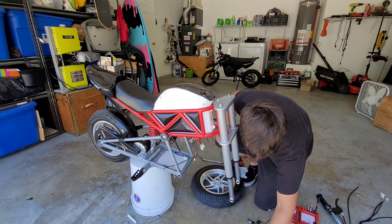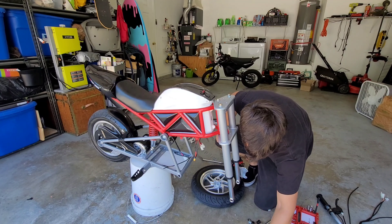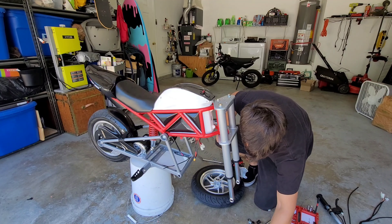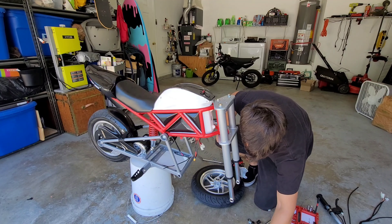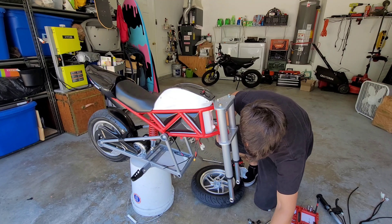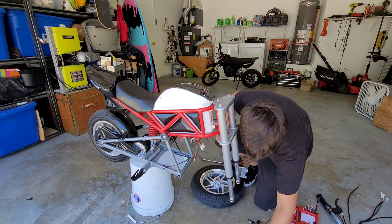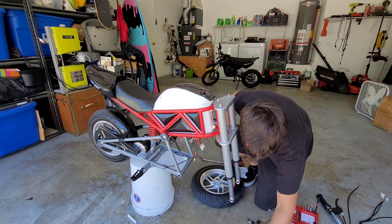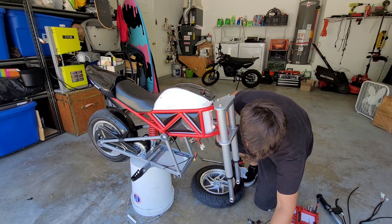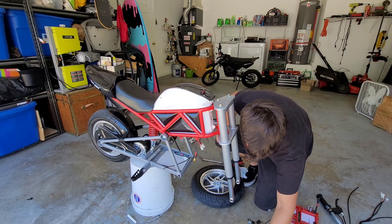Put all the screws in the seat to keep track. If you followed the first half of the video, the handlebars and wires are already pulled out. Don't forget the little diamond plastic clips — take a flat head, pop up one side, pry it out, and they fall right out. Same for the other one. Now we're ready to run the back brake line through.